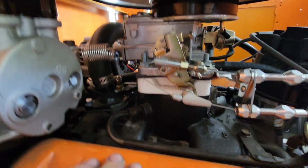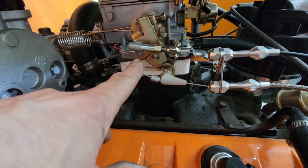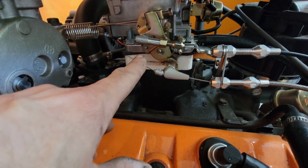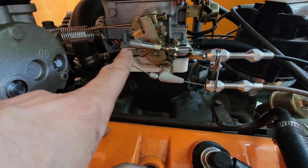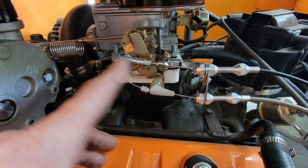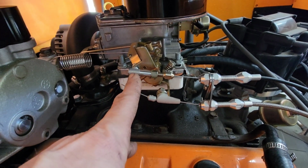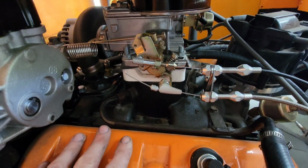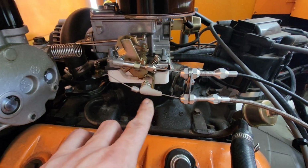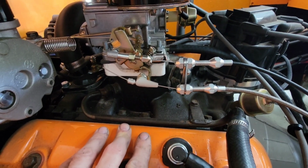This is what I ended up doing to smooth out the cable for the throttle. It was here on that lower one, and I posted up on the groups, and they said my pivot point was too close to the fulcrum, which was causing it to bind a little, making a really hard pedal. So I moved it up to here, and now it's working smoothly. I'm pretty happy about that. And that's the 700R4 kickdown cable from Lokar. All set.